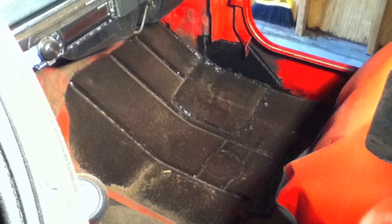And that's what you're going for. This last picture is just the finished product with the running board back on — looks pretty good. Basically, that's how you fix a floor pan that's right up against the rocker panel when it's all rusted out. The main thing to remember is to take your time, work on each piece separately, and don't try to form one piece of metal in an L-shape to fit both the floor and the rocker panel — it doesn't work that way. Do each piece separately and then fuse them together. I hope this video helped — if you have any questions feel free to comment.